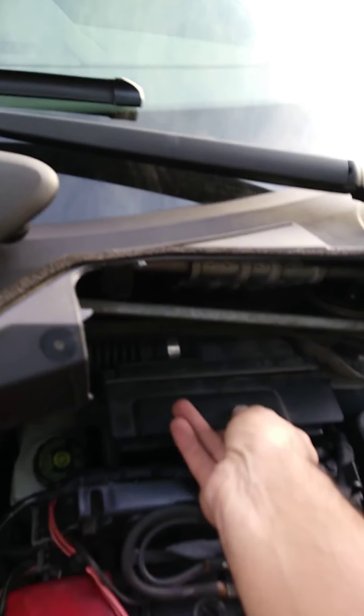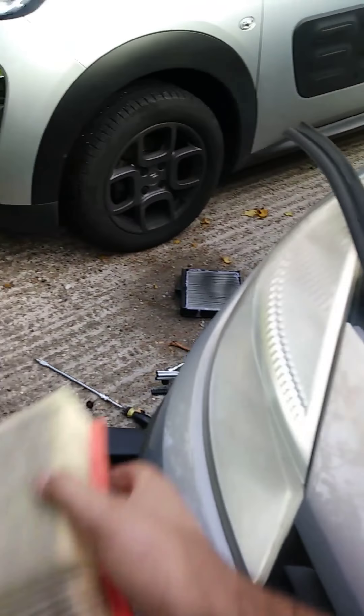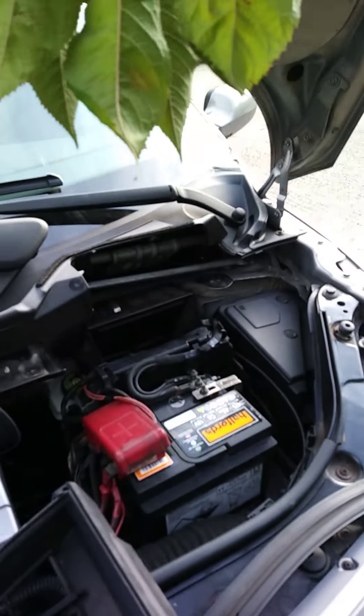That's the old one, so out it comes. At the same time, it's a good idea not to park facing greenery like I did, because a lot of dust can be blown in on a windy day into the filter box and that can affect the performance of the car. There's a bit of dirt there — I'll clean that out. It's a good idea to clean it out and make sure there's nothing blocking the airways.